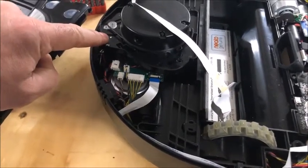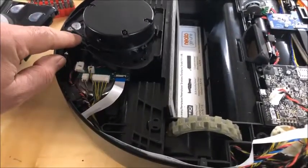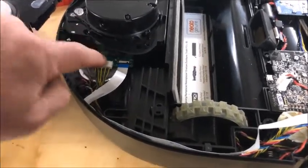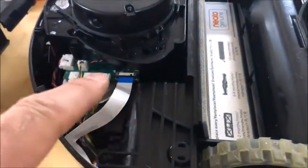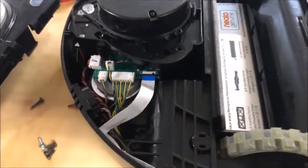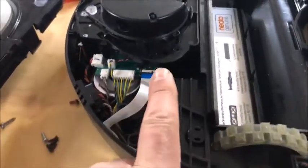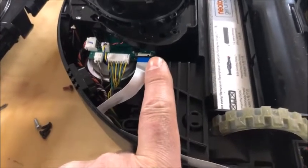So I thought, how am I going to troubleshoot that? If you take this off — I unfortunately already put it all back together after testing — but basically you follow the little red and black cable that comes off the motor to a connector in the back. On the PCB there are leads long enough to clip on little clip leads. I measured the voltage on those pins; I expected it to be in the 12-volt range, and when I turned it on it was getting about 14 volts.